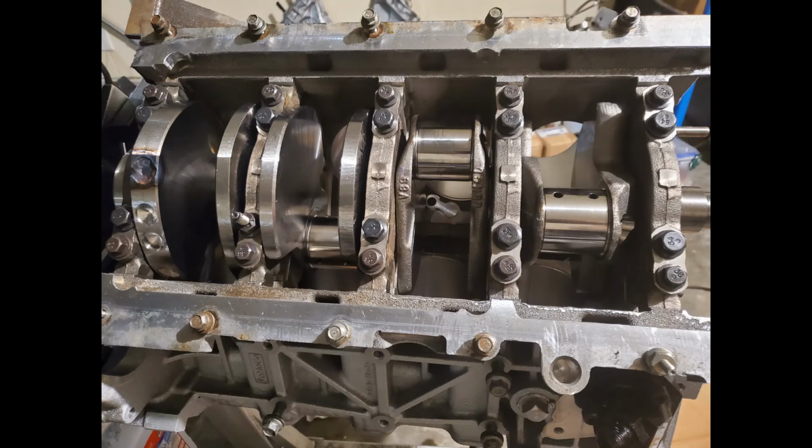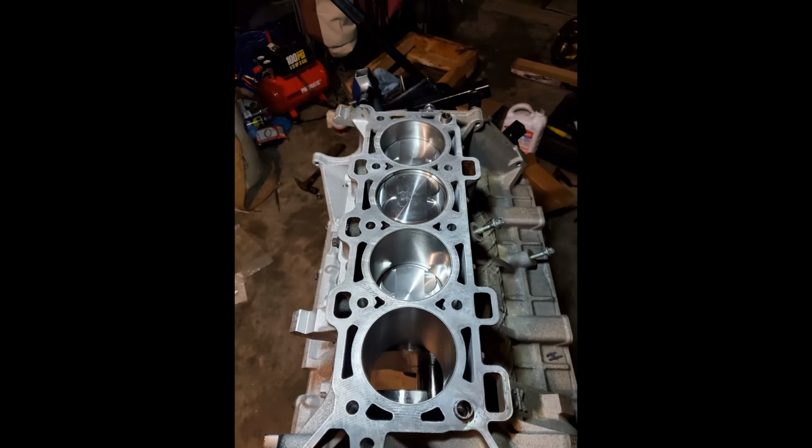And this is the crank seated in the block. You can see on the left hand side there's a plug weld on the crank. That had to be done in order to run this piston and rod combo. You have to balance the crank to the rotating assembly, or you'll make some severe damage to your engine internals. And those are the main caps. You can see they have the OEM bolts, not studs. But I took those out and got ARP. I wasn't going to risk it, and I threw ARP on it, and it worked nice because they're reusable.